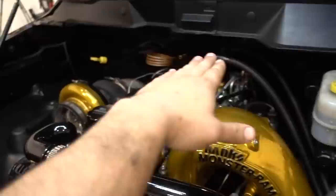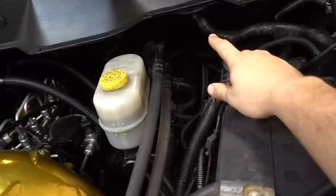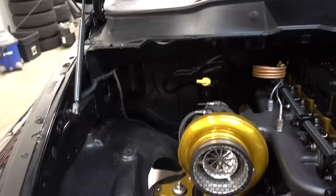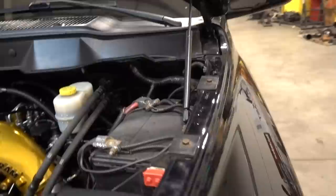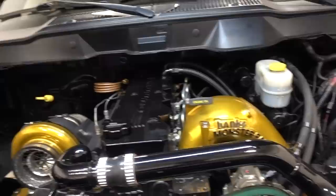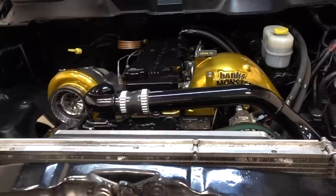I tried to scroll through pretty much all the questions. The only thing I didn't cover was the wiring in the truck. Normally there's wiring that runs across the top of the cowl inside the wiper cowl. I drilled a couple of holes in the cowl, stuffed the wiring up through there so it's all inside — then it comes down through here. Not a terribly hard job: just drill some holes, stuff it up in there. I cut a little bit right here and folded it up — the bigger connectors are right there, but it gives a much nicer, cleaner look underneath.